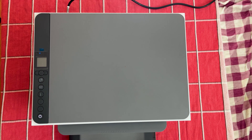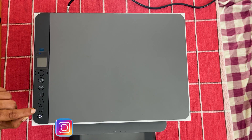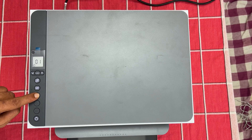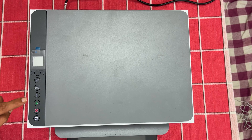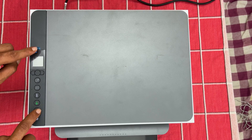To begin with, we need to restore the Wi-Fi setup mode on the printer. You can skip these steps if your printer is new. First, press the cancel button once to ready the printer. Next, press and hold the information button for 5 seconds until the control panel buttons light up — that is the bottom 4 buttons. Now press and release the wireless button and cancel button simultaneously.